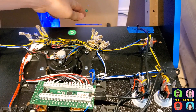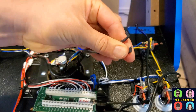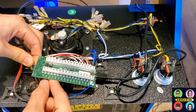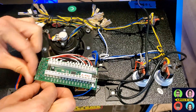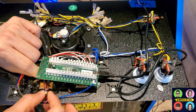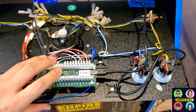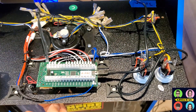Let's reach into the cab and pull out the two wires plugged into the back of that custom inlet module switch. There are two female spade connectors here, and they're just going to plug directly into those two terminals on the switch. I'm going to angle this down and get it plugged in — they should connect and stay secure. Just plug in one terminal and then the other. That should be nice and secure inside the switch once pushed down, and I have them angled so the APAC can fit directly back on top. Screw it back down so it's nice and tight.